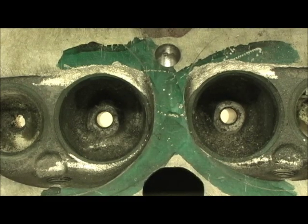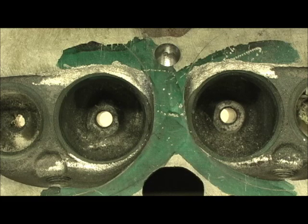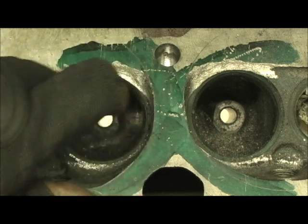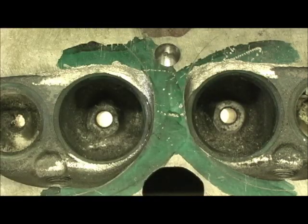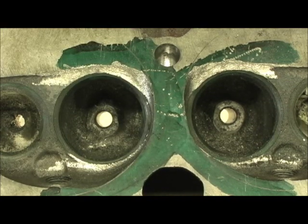So anyway, I'm going to go ahead and finish all the chamber work up. Then we're going to do a valve guide mod — we're going to chop the guide area, do the bullet nose thing, reshape all that to complement the tubes and the entrances that I've done.